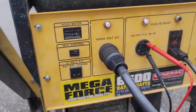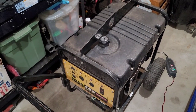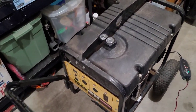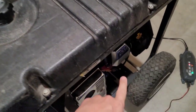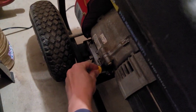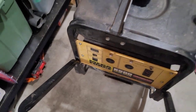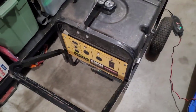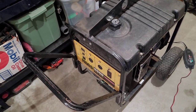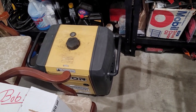That's a wrap on this generator. It's certainly been a good project — getting all the pieces fixed. I was able to finally get the gas cap with the gauge. The new breather hose came in and that's all taken care of — it's not popping off anymore. Got the new oil plug in so I can get my fingers around it instead of using pliers. The new hour meter is in there showing about 72 hours just like I wanted, and we have the two new circuit breakers. This generator is certainly ready for the next power outage. Thank you everyone for watching — if there are any questions, please leave a comment below. On to the next project, which happens to be a very large inverter generator.